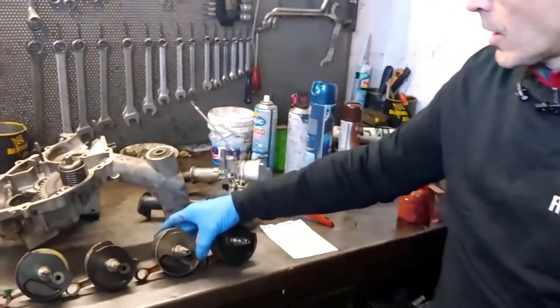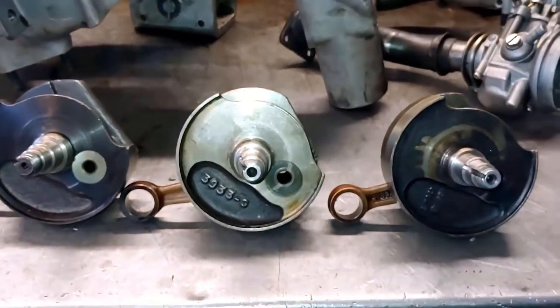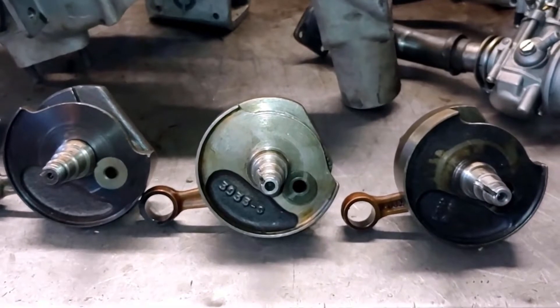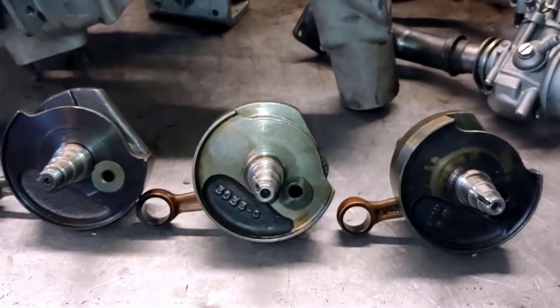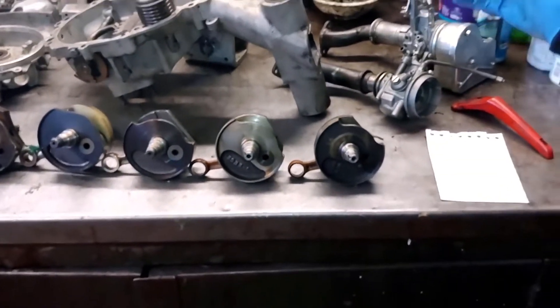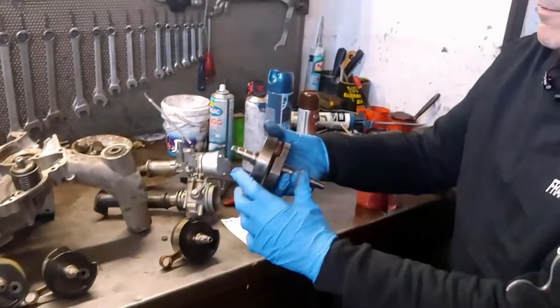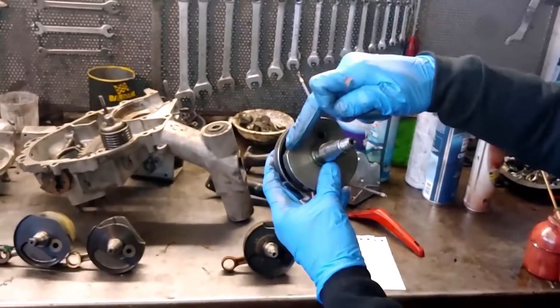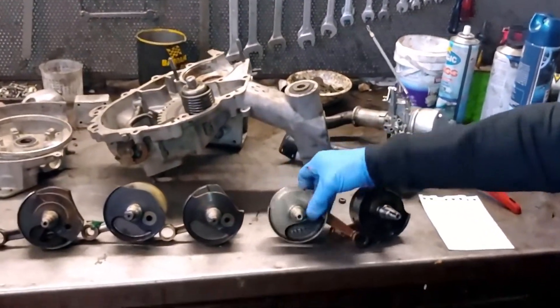This is the shaft of the Vespa HP, which as you can see even by eye is much more open. It has a surprisingly wide phase: 110 degrees intake advance and 45 degrees delay, therefore 155 degrees overall. Keep in mind that this value already accounts for the valve port machining, so this phase comes with a standard valve. If the port on the valve is worked, you gain several very important additional degrees of delay. At standard timing, this shaft is perfect for a smooth 75cc delivery, and being wide timing for the 50cc with a very full flywheel, it reduces the crankcase volume slightly to the benefit of elasticity.